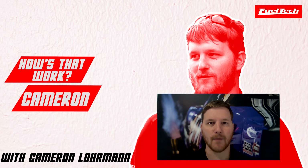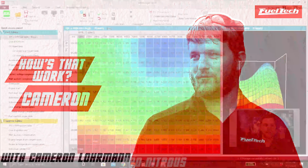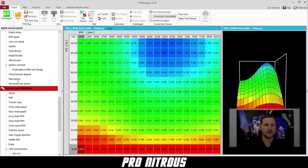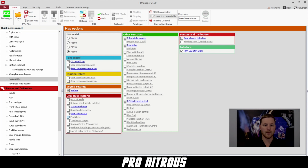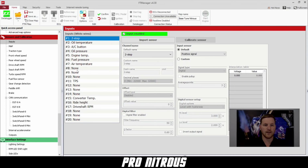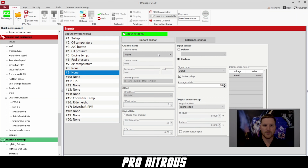Hey guys, today I'm going to show you how to set up the Pro Nitrous feature. The first step in setting up our Pro Nitrous feature is we're going to scroll down to Map Options. We're going to turn on Pro Nitrous. And then next we're going to go to our inputs. Here we're going to configure a Pro Nitrous arm switch.